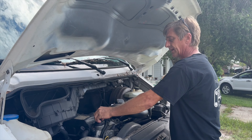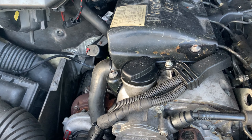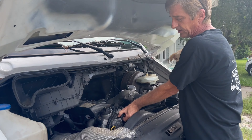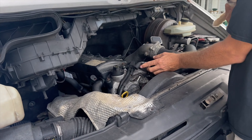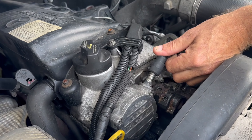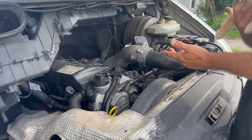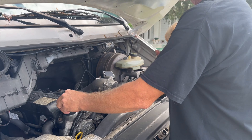If it dances around a little bit like this, don't get upset. It might be that you've got a leak in the vacuum system that's constantly sucking air into the engine. If there's a good resistance from the brake and everything, it's not a lot of air — but if you've got a big leak somewhere, that cap's going to dance a little bit.